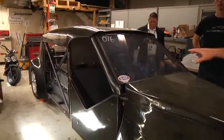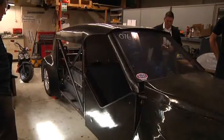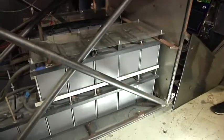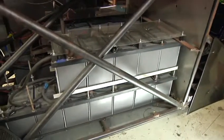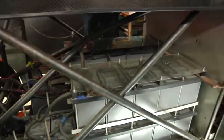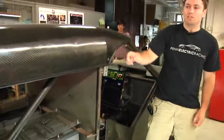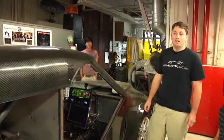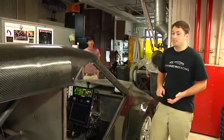In the back, we have two full stacks of 23 sealed lead acid batteries. Those provide just over 300 volts and currents over 1,000 amps. We have a 2,000 amp fuse in the back, which is a one-off fuse — basically means that if it blows, we have to replace the entire fuse, and possibly some of the batteries.